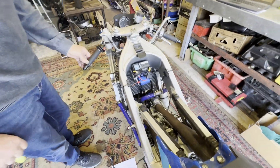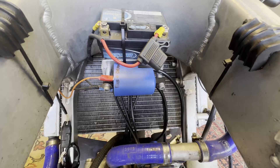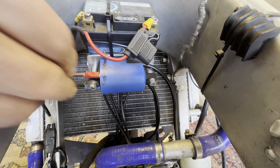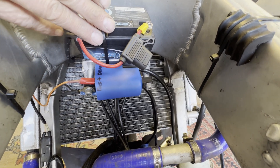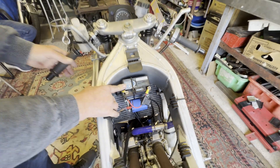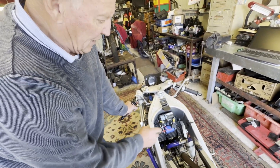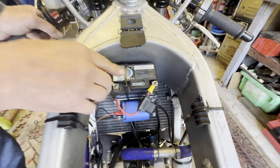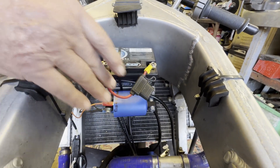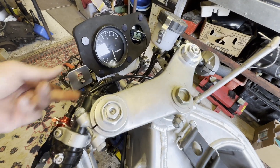Once we got the backing plate made up and got it firing in the right spot, we got a new coil - supplied from Ignitech - a high output coil. On this particular bike we've put a different battery system on it. Originally these had a battery that sat up in the fairing, which was way past used by, so we ended up setting up a battery under the tank. We have power and earth coming up to the front and we've put an ignition switch that powers it up.